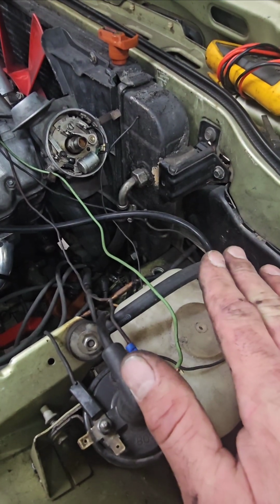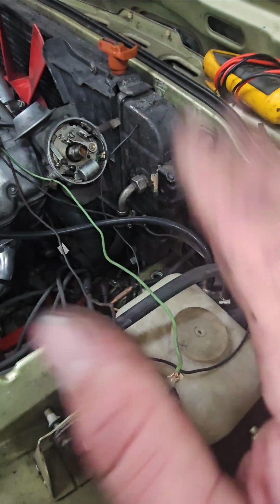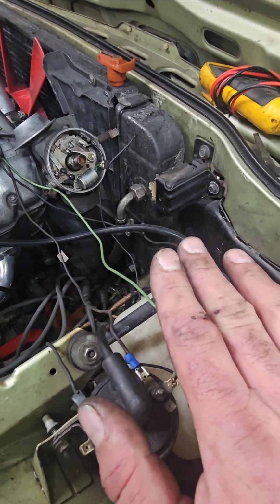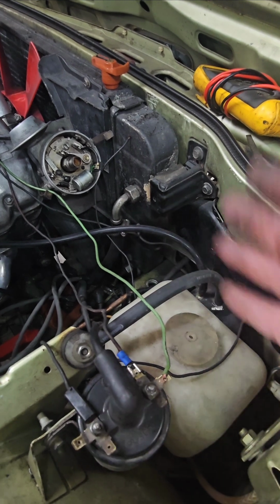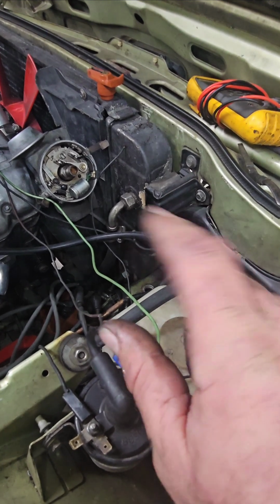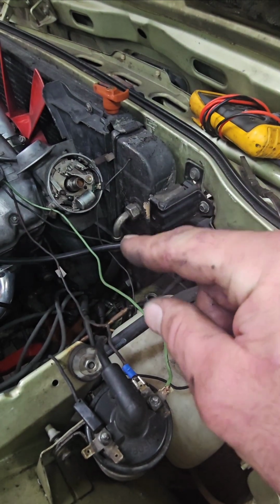I tried that setup, just a jumper from here to there. All this was legit, that was legit. I tried that for probably like a day and a half, and I couldn't get that to work. I don't know why, but if you're having problems like that, check your tachometer. And ironically, that was my whole problem the whole time: when I replaced my dash, I switched the ground for the signal wire. So the wire coming from here to the tachometer was actually at ground.